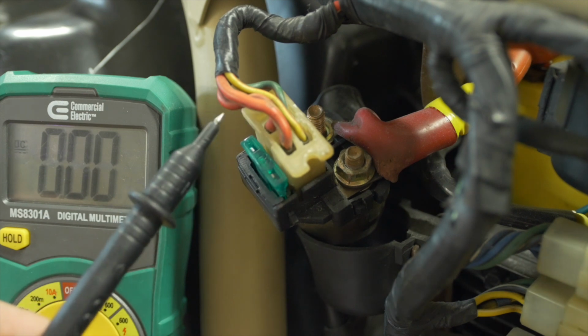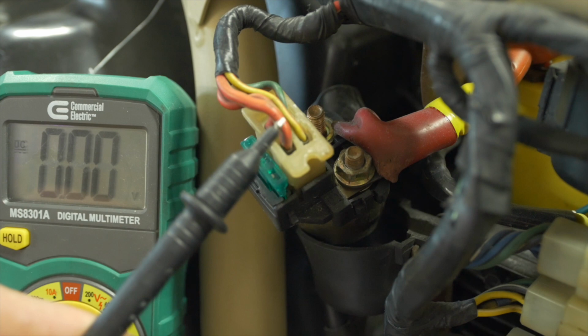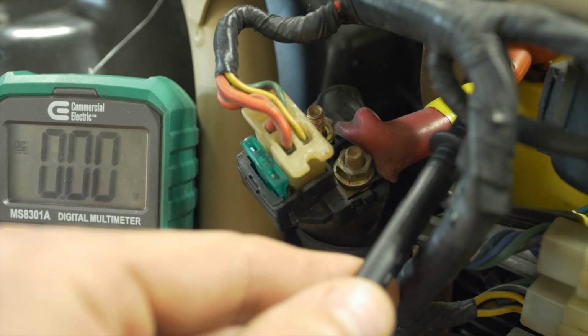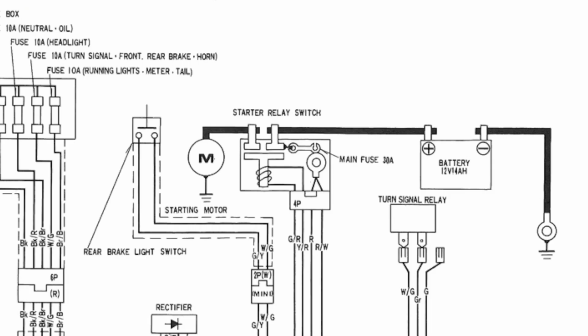I know both of these wires look red. This one has a stripe on it. And the red and white wire to the regulator. And so you think of the power as coming in from the battery here, and it's fused, and then it splits out in two directions. And what that's doing is, on the red side, protecting the rest of the bike's components, the fuses, and on the red and white side, protecting the regulator, or probably more accurately, protecting the battery.